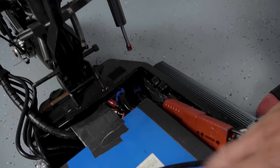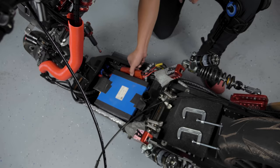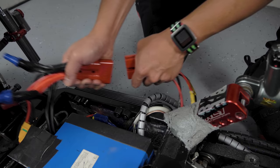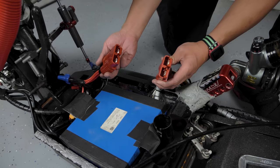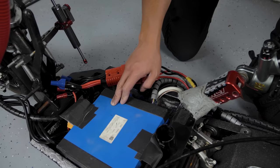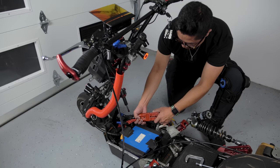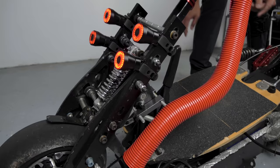So this is the battery from Hercules Technologies — 72 volts. You can charge this at 72, but you can run up to 84, and it's 25 amp hours. I wanted the fattest connections, so I use these connectors. They use a really good type of nickel-silver, hold up to 600 volts and 175 amps. This one, the BMS maxes out at 100 amps, and this one maxes out around 80 amps. I just wanted the connectors to be able to handle it — you can put 180 amps total for the batteries.